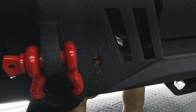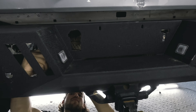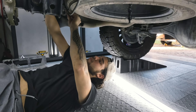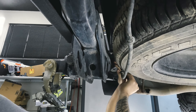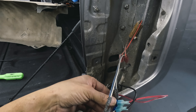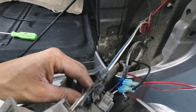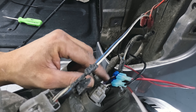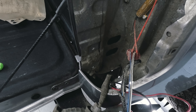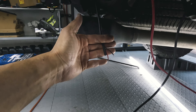Screwing the bolts back in — you can actually see through the bumper where they go. The wire loom harness sits back there, so we need to zip tie it up so it's not hanging, probably to the hitch. Now for the final stretch: wiring the reverse fog lights and flood pods. We tap into the reverse bulb positive and negative using T-taps, run the wire straight down through the taillight housing, and zip tie everything down.